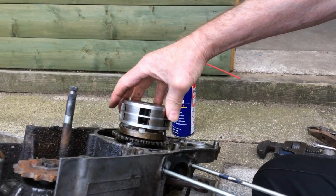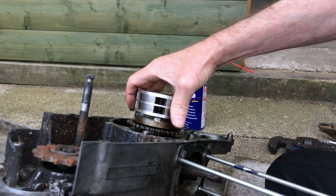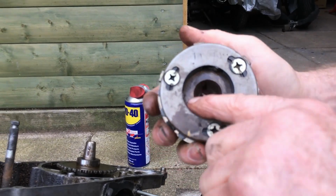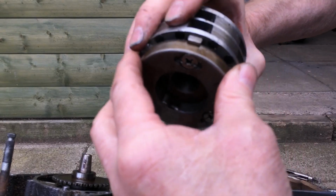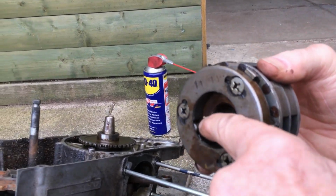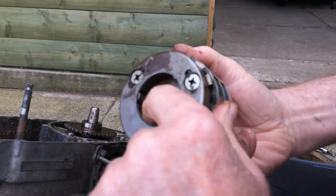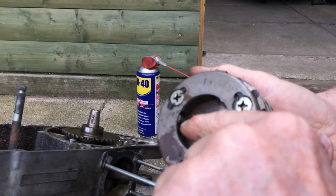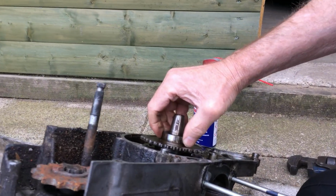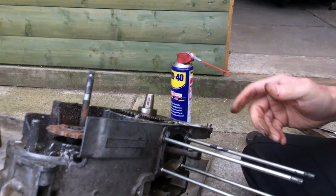So next we're taking the magnet off for the charging system. I've already jacked the bolt off. And it incorporates the sprag clutch for the starter motor, which is like a one-way locking mechanism. Cranks the engine around. When the engine fires, it freewheels. And looking at the bearings and the plungers and springs, the bearing surfaces are all okay. It's like little plungers, springs, a couple of roller bearings in, which rotate on the, here, so it grips that, turns that around. So that looks okay.